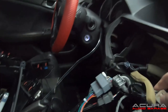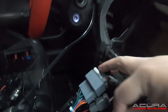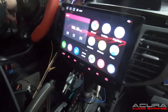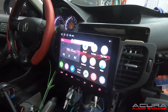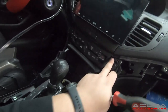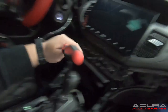When you go to connect your harnesses, the white plug and gray plug here aren't connected. The three connections you use are these three: your main power, sub, and antenna. Our initial tests have passed — our steering wheel controls work, our subwoofer works, and all our speakers are working. Now it's just a matter of getting everything set up and put into place. The middle pocket goes in first — it has to slide into place. Then goes your climate control. Remember the middle pocket has a light — make sure you plug that light back in. Climate control has two connections — make sure you plug those back in.